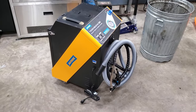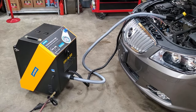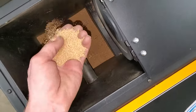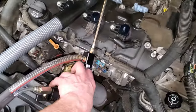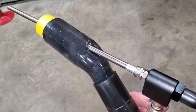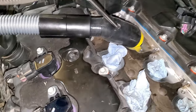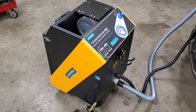Now it's time to use the walnut blaster. For those who've never seen it used before, the operation is very simple — we have shop air going into the unit that forces very fine walnut powder through this black hose and out the nozzle, which has a little trigger. The nozzle of the blasting gun sticks through the rear of a silicone adapter which gives a good seal when pushed into the cylinder head. Any walnut shell blasted at the valves gets sucked up through a hose that connects back to the machine's internal vacuum. That's all there is to it — let's get to blasting.